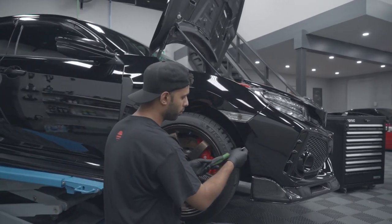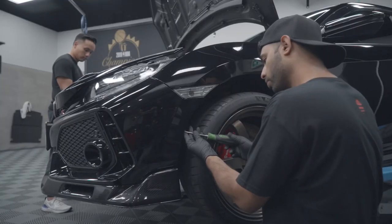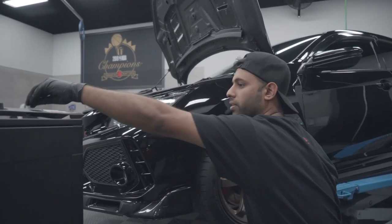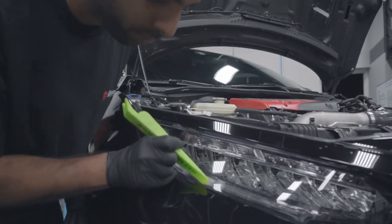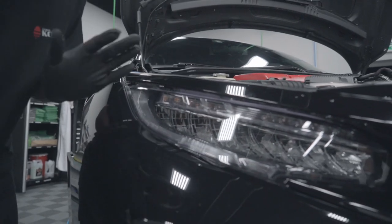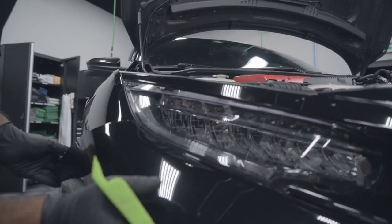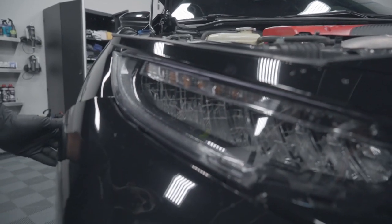Right by the corner left, there are two screws — take those out. There are also two small clips, one here and one here. The bumper is forward a little so at least you can see them. When you are taking the bumper off, you're going to lift on those tabs — that's what's holding the bumper in.